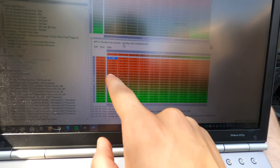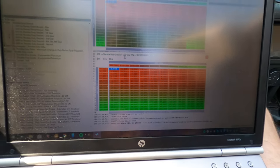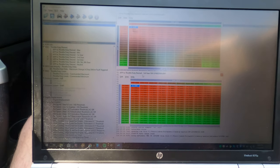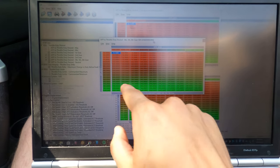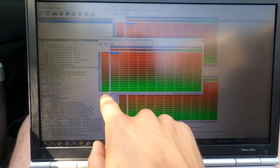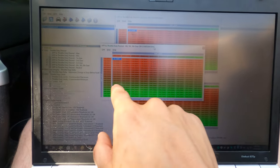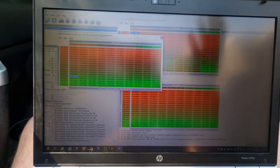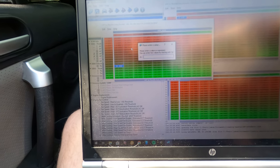What on earth? And then in third gear, it's actually the opposite. It is higher in some of them. That's hokey. I don't know about that. This probably makes the car drive smoother or whatever, but I want a manual because I'm a control freak. And when the car isn't doing what I want it to, that makes me unhappy. So I think fourth, fifth, and sixth gear table here, which just popped up. What? It's still weird. I don't understand. 90% throttle is 99% throttle, 70 is 77, 60 is 67. That's bizarre. I don't know about this. I'm going to change all these so that they're 1-to-1, just because I'm like that. So I'm gonna make 45, 45. I'm gonna make 50 equal 50, and so on.